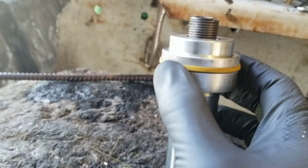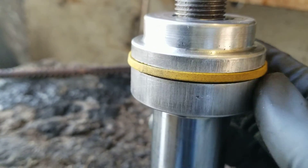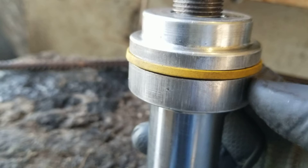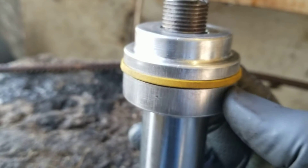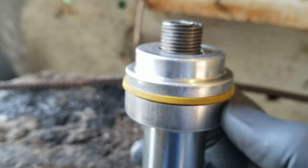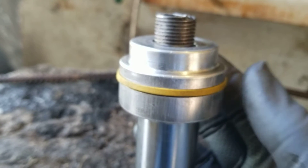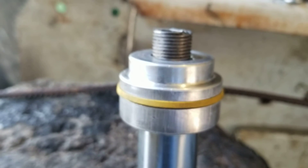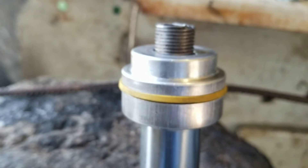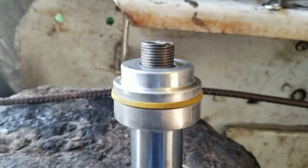When you're sliding it into the piston, you'll see it sticks out a little bit right there, so you may have to tap it in to get it — it's going to be real snug inside that cylinder. You might have to tap it in just a little bit but it'll go in. Once we get it in we'll screw it back together and hopefully get things started, then just bleed it out.